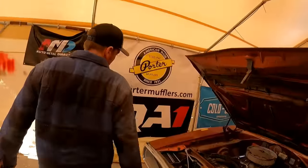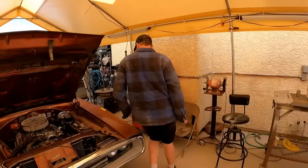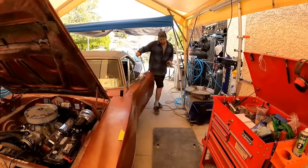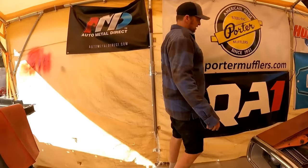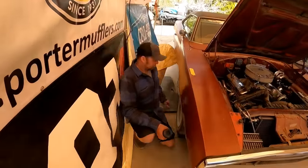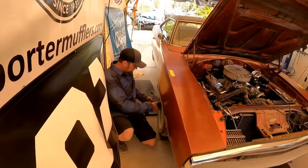And the steering wheel might not be perfect. You know, I kind of have to eyeball it. Actually, yeah, it is toed in. So let me just turn that wheel out that way just a tad. See, I automatically knew it was toed in from before. See, I'm just kind of eyeballing it. And that looks pretty good. Later, we will actually run a string down the car and we'll check the toe compared to the chassis, and then we'll fine tune it on the street.